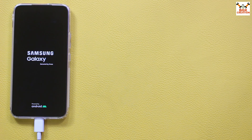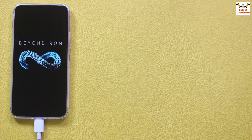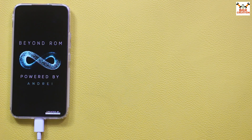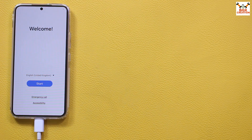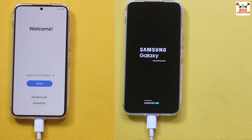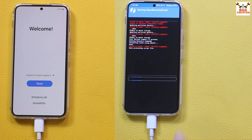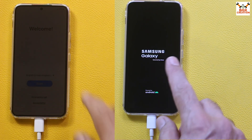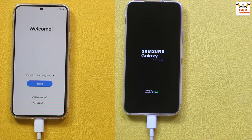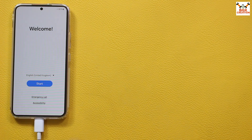Tap Reboot System — the phone will start booting. The first time it appeared to be booting but was actually in a boot loop, which is why I rebooted into recovery and did Format Data. This may or may not happen to your phone. The phone started booting again and finished the first boot. When I flashed this ROM the first time, the first boot was not completing, which is why I did the Format Data step — the phone booted straight to TWRP recovery. After re-entering TWRP and doing Format Data, the first boot completed successfully.